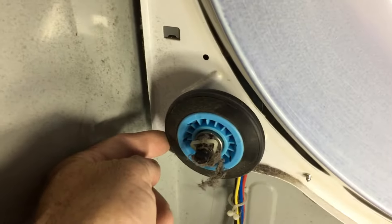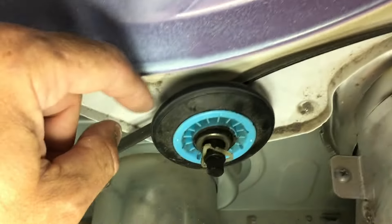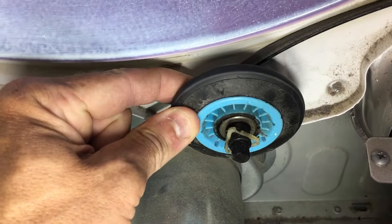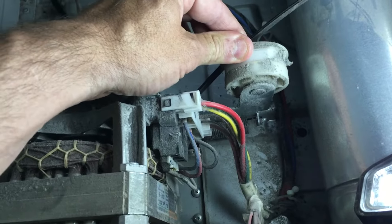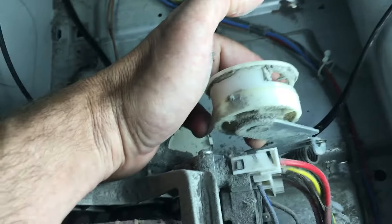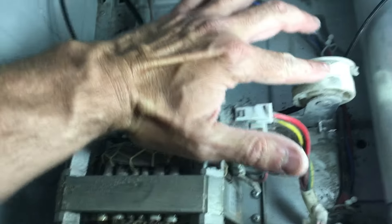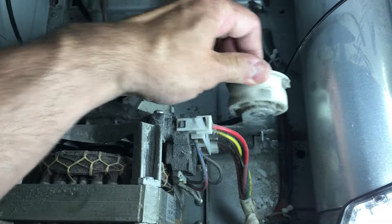Here's where we've got some work to do. Number one, we need to vacuum everything — there's lots of dust. This is a normal bearing: the metal part rotates on some wheels. Here's our failed bearing — the blue plastic part has completely separated. It was still rolling, so that's why it was still working, but it's obviously not something you want to keep. Coming down to the idler pulley, it's actually completely seized. You can see where it's quite damaged — the belt has just been wearing and slipping on a very smooth, slippery surface. The motor was just powering the belt through it.